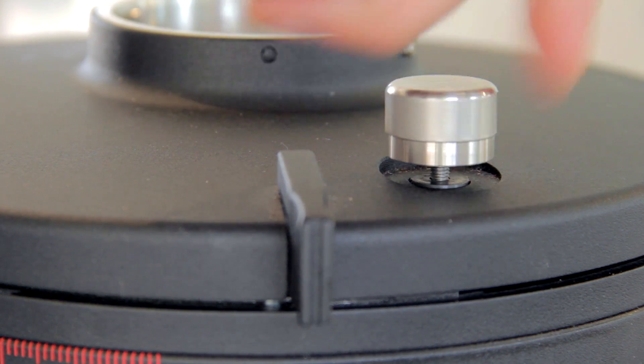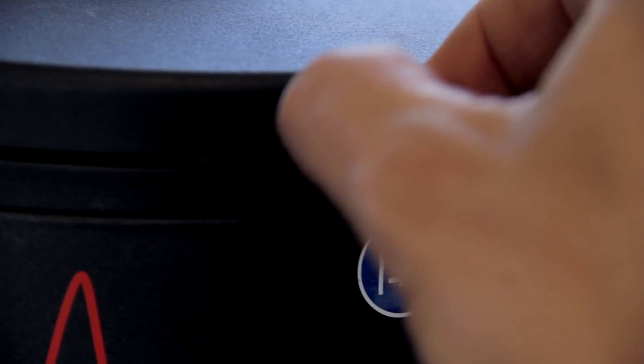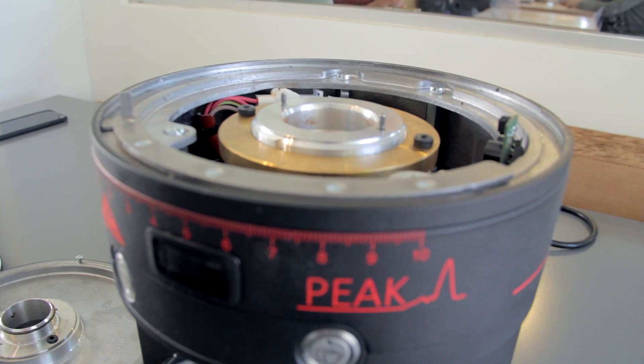You'll put the lock screw on but don't tighten it down all the way. And don't forget about the set screw on the opposite side of the grinder — this will keep the lid from popping off. If you didn't have the lid off, you don't need to take any of these parts apart to calibrate it. You can just start where we're at right now.